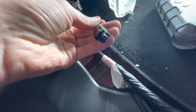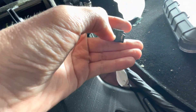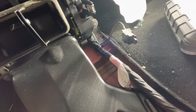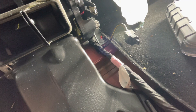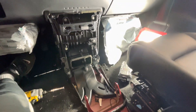You got a ground wire right here, and then this right here is for your USB stuff. If it has a cord like this, one of these plugs, it means the car has USB functionality. Previously, back in 2021 during the chip shortage, Tesla wasn't offering this, so you couldn't plug in USB controllers or sentry mode cameras — you had to go through the glove box. This means I can plug a USB controller into my center console.